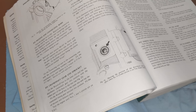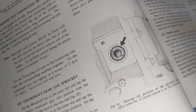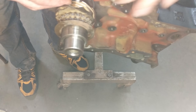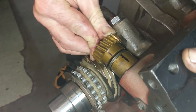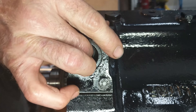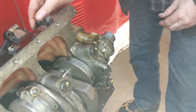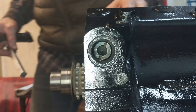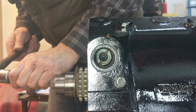Next up, the distributor shaft. The distributor shaft needs to be in this orientation when installed with the number six piston at top dead center — the offset keyway pointing right towards the threaded hole for the distributor clamp. We drew the shaft up and out of the way, and you've got to put that gear where there's clearance on the cap, making sure the keyway is pointed right towards that bolt. Then we can slide the crankshaft gear into where it wants to be. Going to try starting in at 7 o'clock and see if driving that gear home gets the keyway pointed towards the bolt.